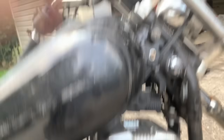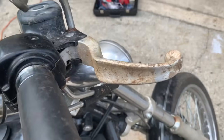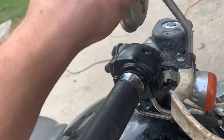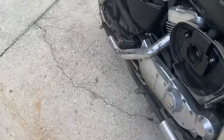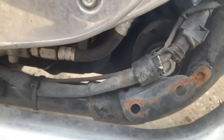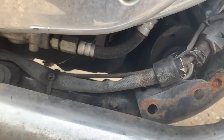Need a brake - it works but it's a little bent. Mirror's getting it too. Front fender, man, that thing's tweaked. I pulled it back just a little bit so it was off the tire, but that's nothing. Just need to get this front right foot peg right here - the bolts are broken off in it. Someone must have really needed it more than I do, apparently - they just snapped the bolts off in it. Needs a new foot peg. I'll drill all that out, retap it, and put a new foot peg on it.